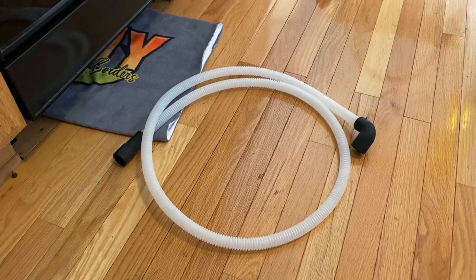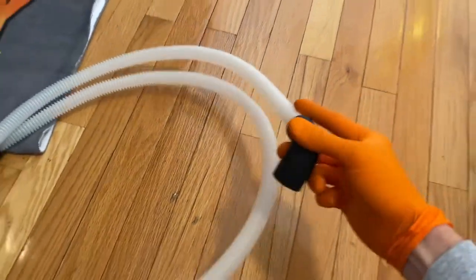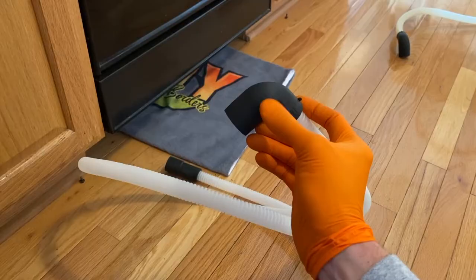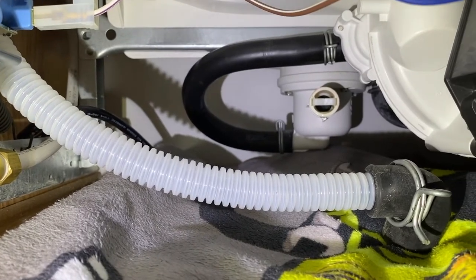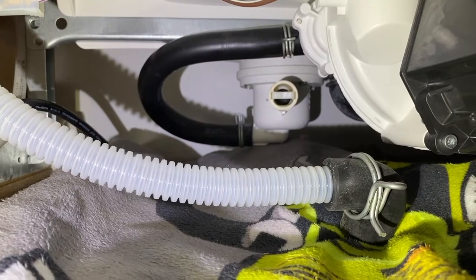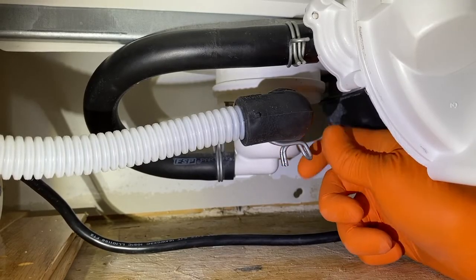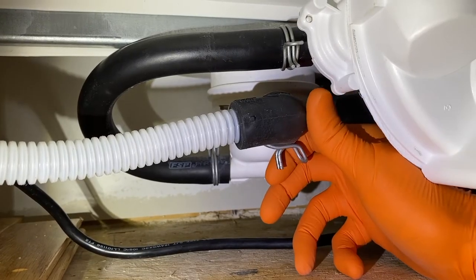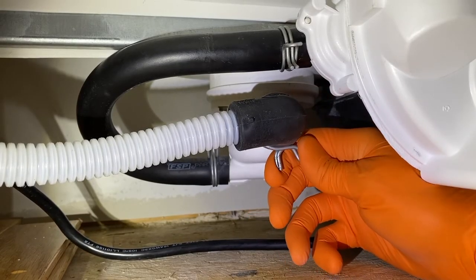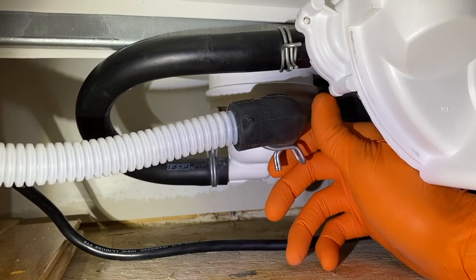Time to open up the new drain hose. Here is all the information for your convenience. New drain hose in position. We are going to have to insert the elbow portion first underneath the sink up at that upper hole — just feed it through the hole, be very careful as you do this, you do not want to harm anything — and feed it all the way through to the bottom portion of the dishwasher. Back down below the dishwasher, the new drain hose is in position. I've also installed that clamp. All we'll do now is connect the drain hose to the connection point. The hose is properly installed on the connection. It's very important that this rubber fitting here is pressed in place. On the back side, you have plastic tabs — push this hose on until this rubber boot is flush with those tabs. After that, go ahead and compress the clamp and shift it into place to lock this hose on the fitting and create that watertight seal.